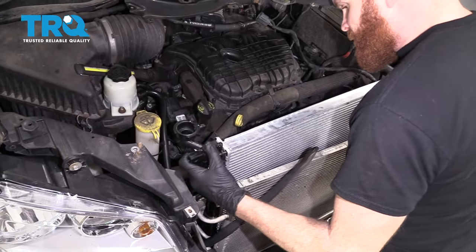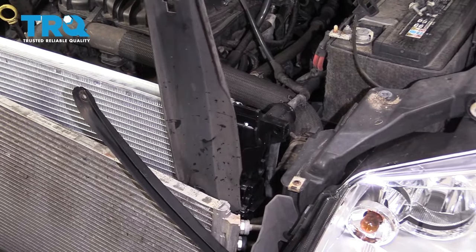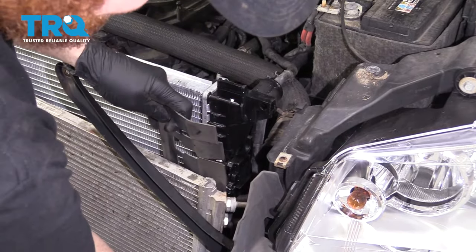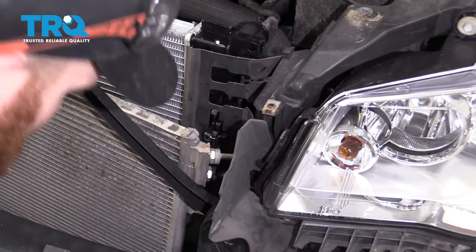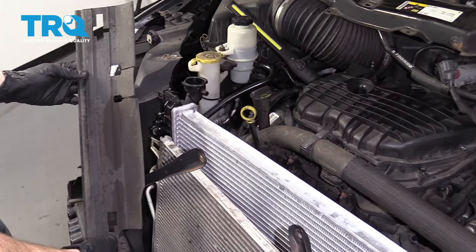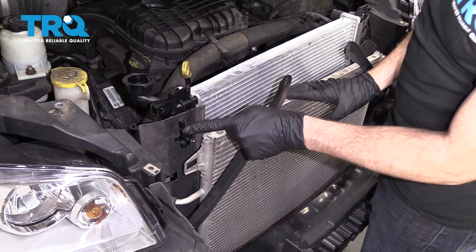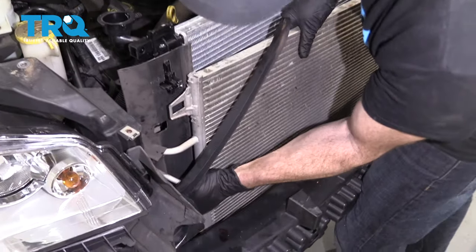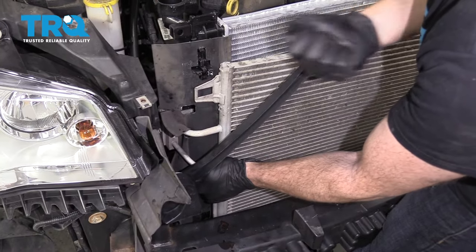It should come down. Let's get this back in there — go right over this, just like that, and the same thing on the bottom. Do the same to the other side. Now it's time to finagle this so we can get our AC condenser mounted up onto the radiator. Whatever you've got to do to get it up on there — but be careful of the fins. You don't want to crush them or potentially stab a hole through them.